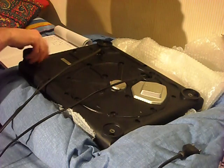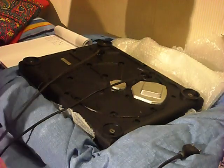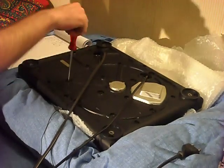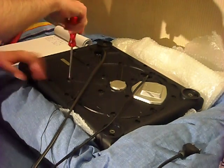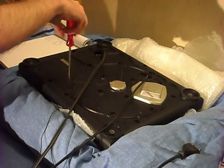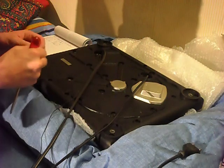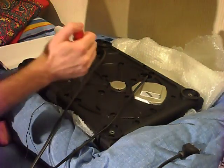First of all, I unplugged the wall, removed the platter, counterweight, cartridge and everything that could be removed. I put the unit on a very soft surface, like on my bed. Now I'm removing the rubber base. There are three types of screws which I'm keeping separated. James has a brilliant video with lots more information about undoing those screws.